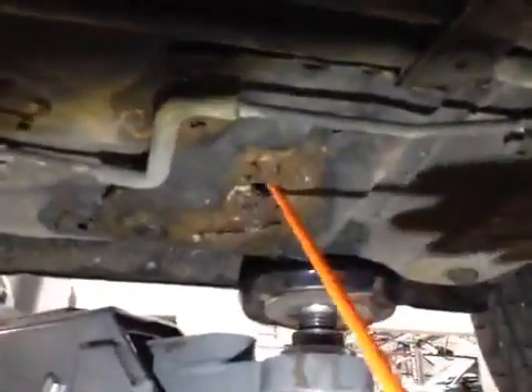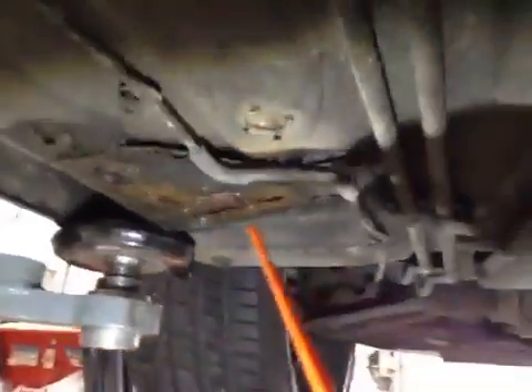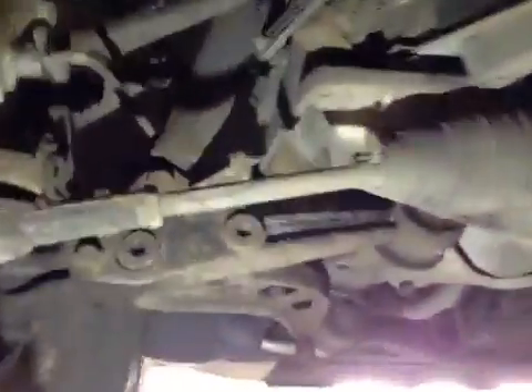Tyre's in green on the health check. The front disc corrosion is visible here, as you can see, and on the driver side again corrosion is here. All the transmission is looking OK. The vehicle has failed the MOT on the passenger side sill, which requires body shop assistance. On the front of the vehicle, round the back up here, there is corrosion on your chassis legs on this side and on the driver side, and this also requires body shop attention.